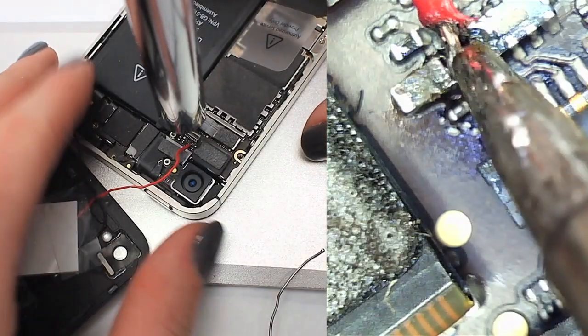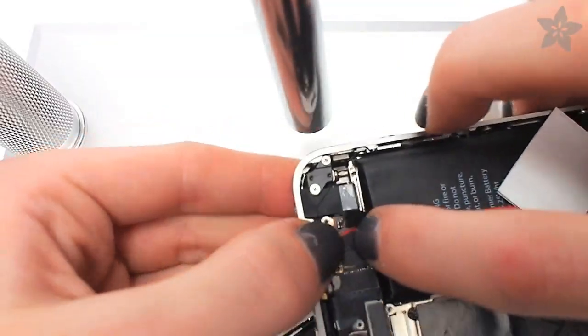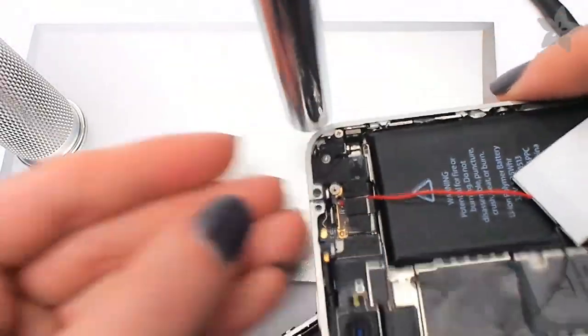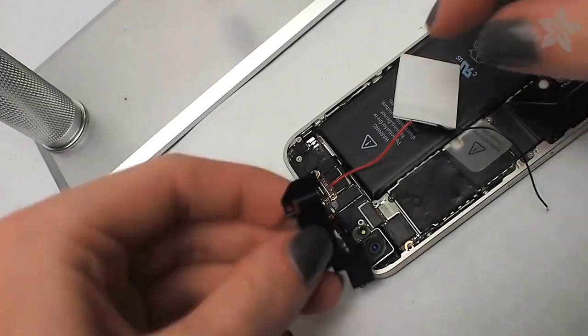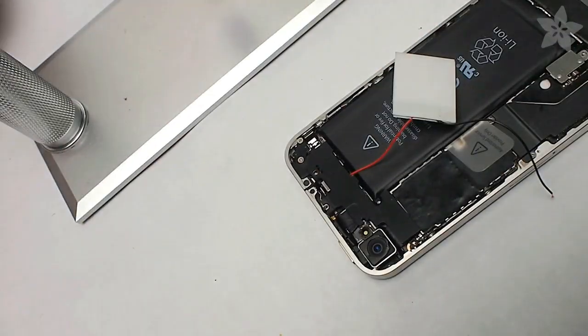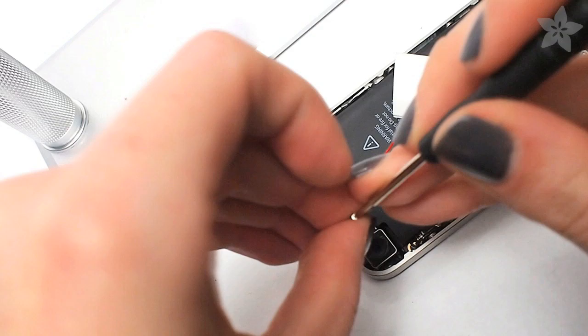Here's the spot where you want to solder for the iPhone 4S. Close the connector flaps you opened earlier, making sure that the wire goes between them and doesn't prevent a good connection. Then plug the power cable back in and secure that screw you removed earlier. Replace the shield that protects the circuits near the top of the iPhone with all five screws that you laid out so carefully, making it easy to put them all back in the right place.